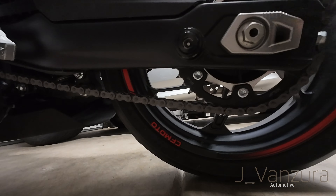So now we just have to tighten up the axle and we should be good to go. This axle nut here — the manual says 105 to 110 Newton meters, which equates to about 77 to 81 foot-pounds. But I'm a little bit confused because online all the forums say do not tighten it that much, you'll break the wheel, the axle bolt and so on. So I don't really know what to do here — I'm just gonna go 75 foot-pounds and hope that's good.